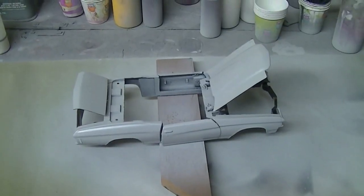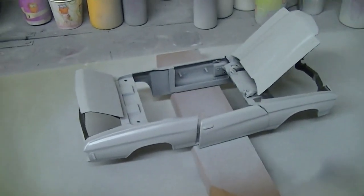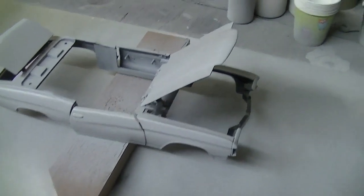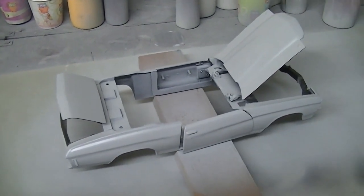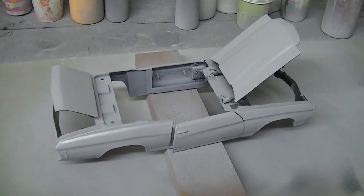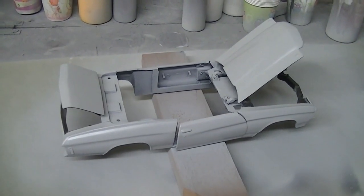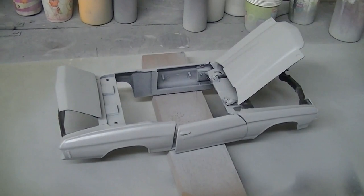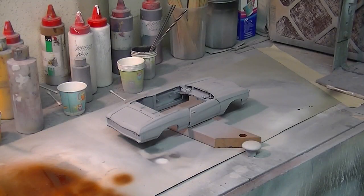In this shot it's had about three coats of Duplicolor Perfect Match Primer applied onto it. You can see that sprays on there really smooth. I sprayed three coats on this and each time it dried, I wet sanded it in between with some 600 grit sandpaper. We got everything smoothed out really nice. You can see I've got the hood, deck lid, and door open so we made sure we got paint in all the areas. I use what they call a tack rag — a little rag with wax embedded in it — so it removes all the dust and lint. Here we have it ready to start spraying.